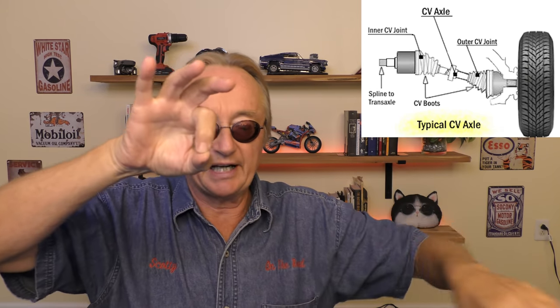Darren Link asks: it's a 2009 Honda CRV all-wheel drive. I drive a lot faster than 60, and when I let off the gas the steering wheel shakes — it goes away when I brake or accelerate. What could be the problem? Since it goes away when you brake, it certainly isn't warped brake rotors — because if it were, braking would make it shake even more. It's a deceleration-only shake. You probably have a problem in the transmission or all-wheel drive system, because when you take your foot off the gas there's back pressure on the drivetrain that can make it shake. But pray it's something simpler — look at the front CV axles. There's a CV joint on the inside and the outside of each one. If the boot is ripped and the grease came out, I just fixed a car like that the other day — only the boot was ripped on the inside and it made it shake. I replaced the whole axle from AutoZone for a $59 part and it went away. So pray it's something simple like that, not internal to the transmission system, because it's a lot cheaper to fix.